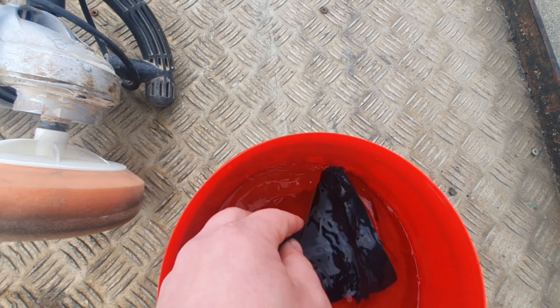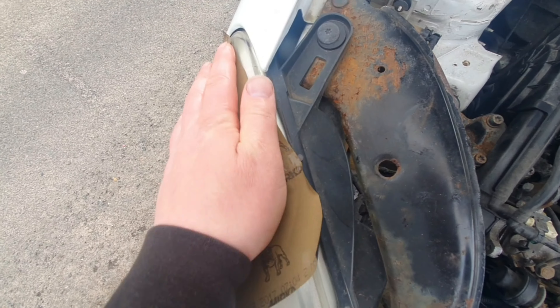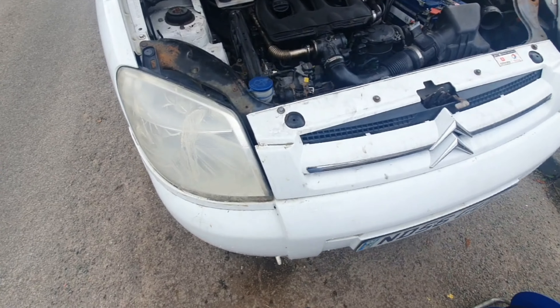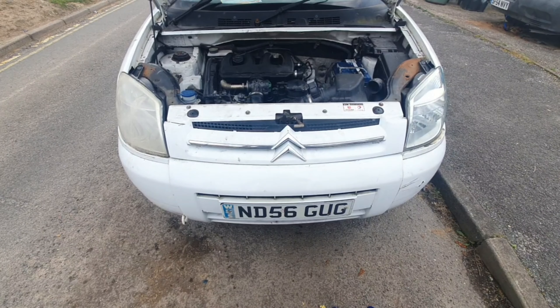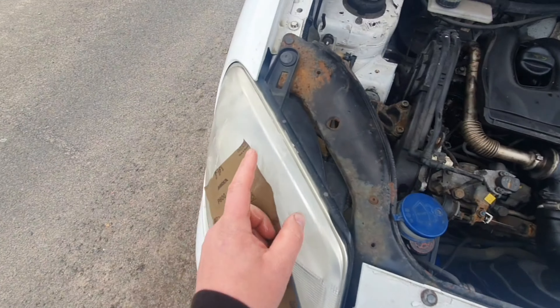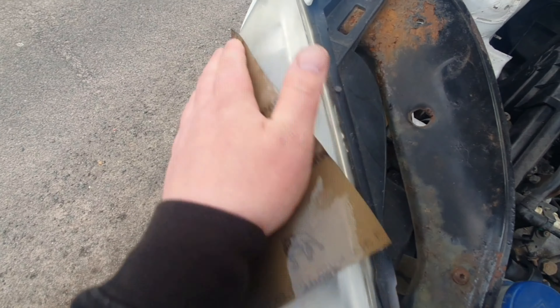First, I'm going to wet and dry the headlight. You'll see a film coming off. After we've flatted it off you won't feel any roughness — I need to get a bit more. So this is a before and after shot; I'm just going to carry on flatting. Make sure you get all of the headlight, just on the little bits. You can see the film just coming off.